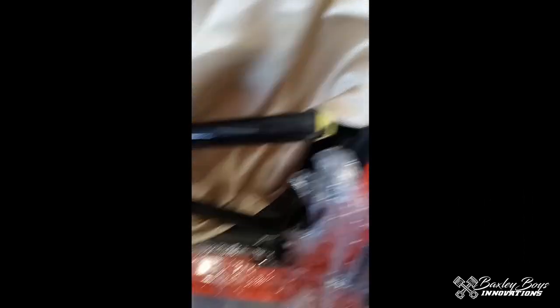I'm gonna show you what I have cut with the sawzall and what I need another sawzall blade for. This is not a race car — well, this is not Billy Bob's dirt track car down the road — so we want this done right. I think a four-inch zip wheel cut-off disc would end up nicking something and I'm just not about that life. I was able to cut the masking tape line bars with the sawzall, and that one with the sawzall and the four-inch wheel because it's wide open with no worries about nicking anything.